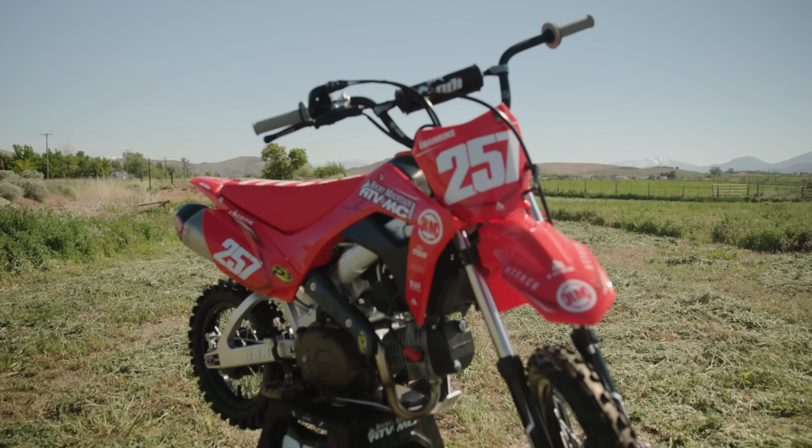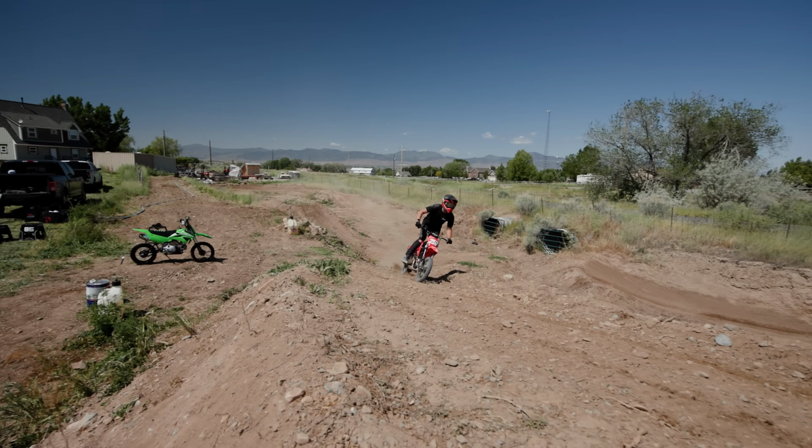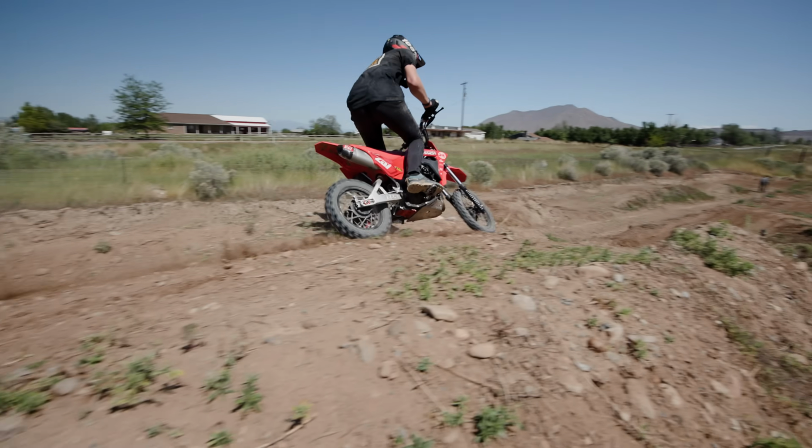Now to wrap those new wheels, I added the Tusk T35 MX tires. Now, one really cool thing about these is up until this point, and this bike actually, none of the major manufacturers offered a true front replacement for these little bikes. They're basically forcing you to run a narrower tire. Stock, this is a 7100, and all the aftermarkets were 6100.